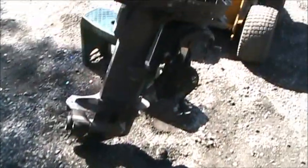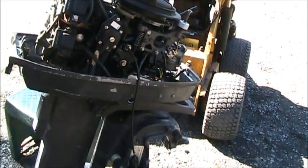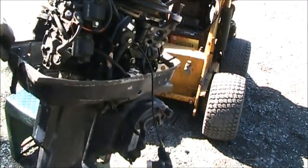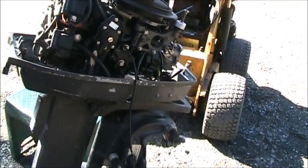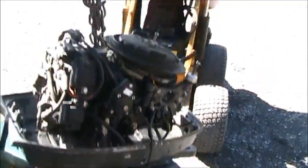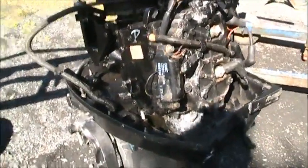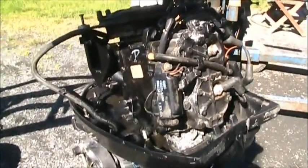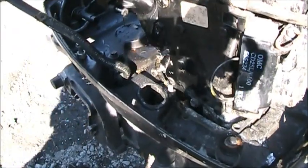because it's coming off, you can see, I drilled a hole here. I drilled one back here, actually two. That allowed me to get in there with my screwdrivers and stuff. And what the main problem with this guy being so tight, see that? One stud right here. Solid white from salt, so it was stuck.